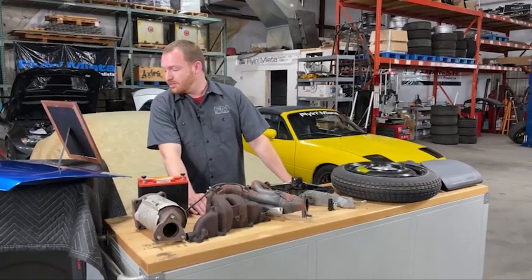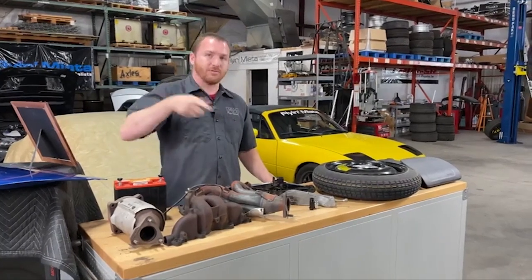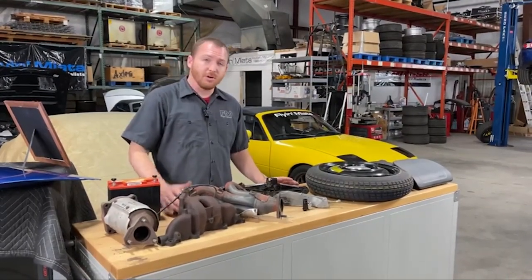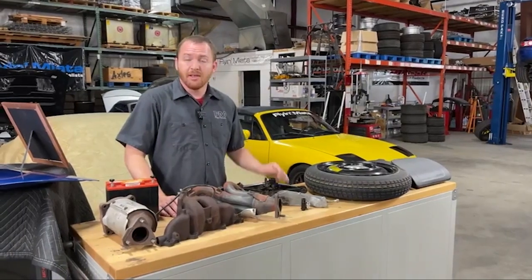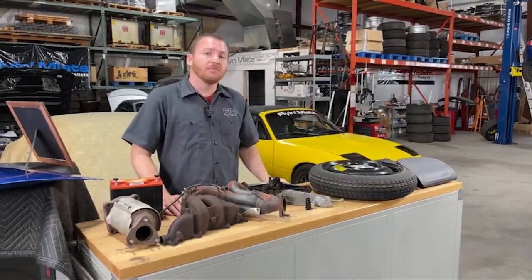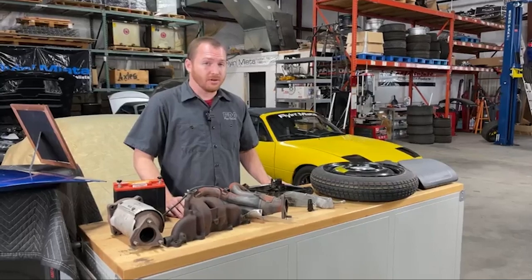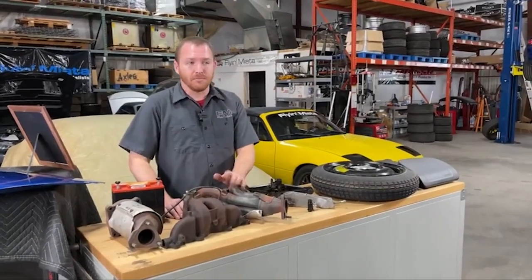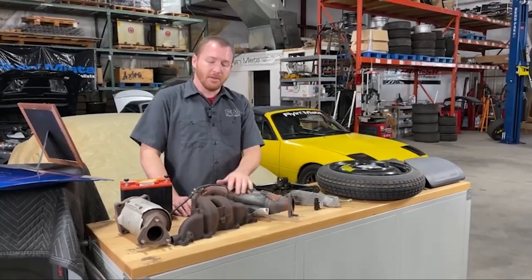Another one that's very common is to remove the power steering. You've got a pump, lines, a small cooler, and fluid traveling around all of this to make the magic happen. By removing all of that gear, you're saving somewhere between about 10 to 13 pounds altogether — not even including fluid; I think our measurements were just dry. So it's a good amount of weight, more towards the nose of the car that you can shave off. And if you like a manual steering input, win-win. I recommend you go drive a friend's car that has manual steering and see what you think before you pull it out.